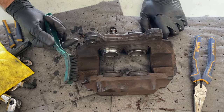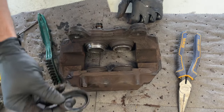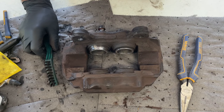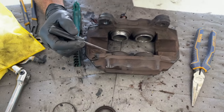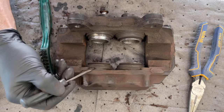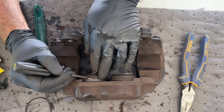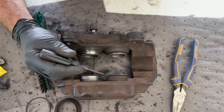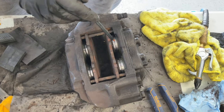This job is going to be dirty — you'll want some plastic brushes, a lot of brake cleaner, and a lot of rags. I already got one of the dust boots off with the metal retaining clip, and now I'll show you how to do one. The retaining ring is split so you can expand it. I'm using a small flat blade screwdriver to get in there, move the metal retaining clip, and work it off. The boots then pull off nice and easy. We're going to do that with each of the four caliper pistons.